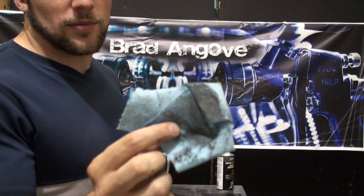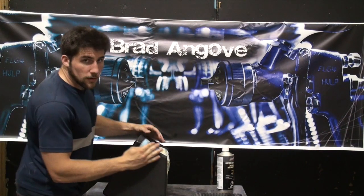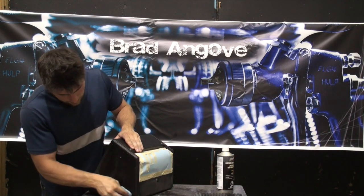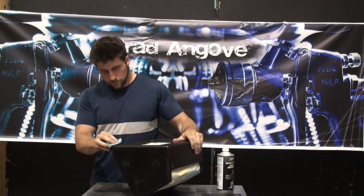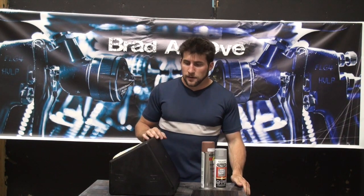Now that that's done, it's time to clean it. I'm going to take a shop towel and some wax and grease remover. If you don't have wax and grease remover, you can get away with something like lighter fluid or Windex — something that functions as a degreaser and doesn't leave a big residue. It's very important to clean these things once you're done sanding them. Even if you've got an item that you don't need to sand, make sure it's not dirty when you go to paint it. You can see I'm taking off quite a bit of residue with that.